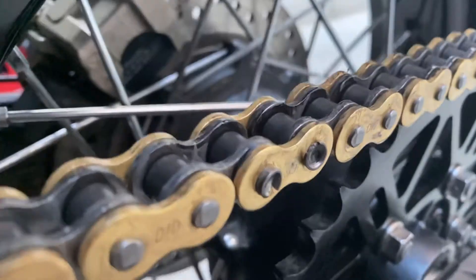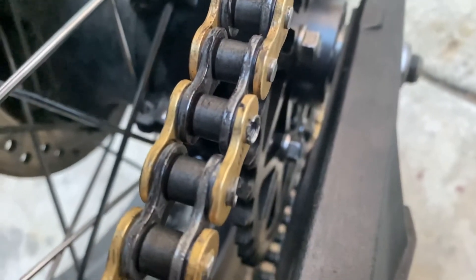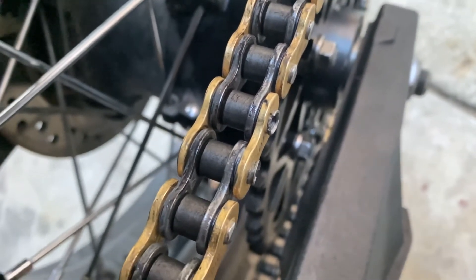The problem was I didn't have a measuring tool to actually tell how far apart the chain link itself is — which is around 19.2 millimeters wide. With this Motion Pro PBR chain breaker, chain setter, chain riveter tool that I have, you're supposed to press it in just enough and then rivet. But I over-pressed on the rivet, causing one of the sides of the rivet to crack.